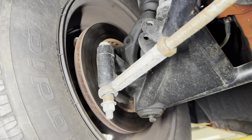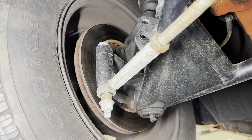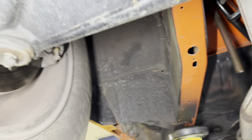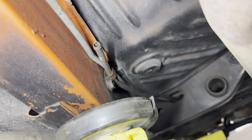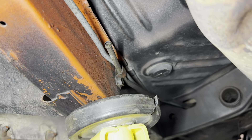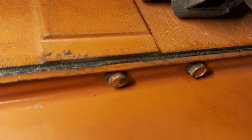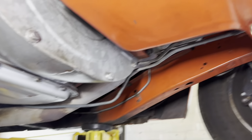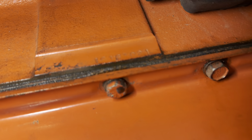There's a lot of little things on this car that need to get fixed - no splash shields on the disc brakes, and those are Wilwood disc brakes, which is expensive and racy, not really meant for the street. There's an open line I'm pretty sure is just for emissions - I think this is a California emissions car. Since it's numbers matching, the VIN is right there on the engine, on the passenger side pad. You want the casting date - 9/14/70. We just looked at a couple of cars last week where the VIN was re-stamped, so you have to look at the whole picture.